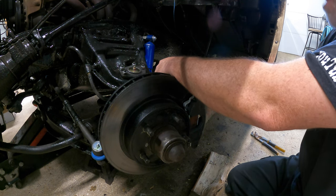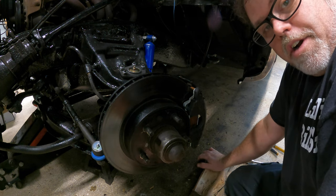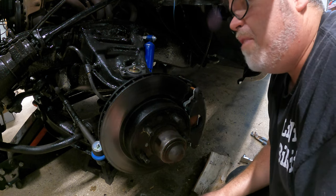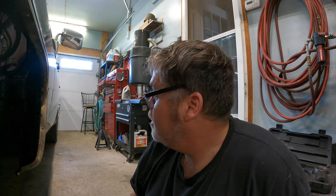So on the front end we got new uppers, new lowers, new inner and outer tie rods, new sleeves for the tie rods, new shocks, new brake pads, new upper and lower control arms, and a sway bar bushing. Now all we've got to do is throw the tires back on and torque them this time — hopefully they're not coming back off for a while. Then we can move on to the back. I already removed the rear shocks so when they come in we'll go right under the back end and put some shocks on. Then it should be good underneath — done and ready to go, except for the inner fender wells when they come in. Hopefully you enjoyed this video, don't forget to subscribe, like, and hit the notification. Love y'all!